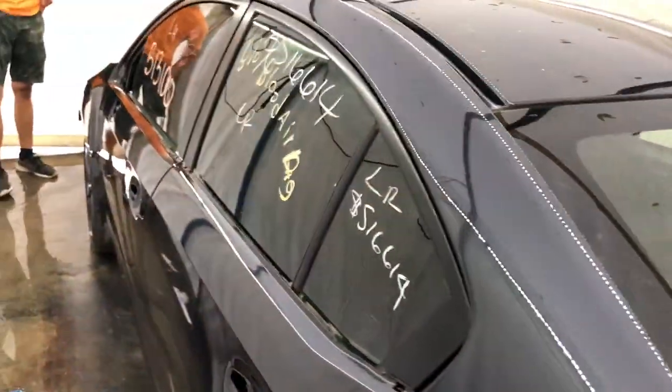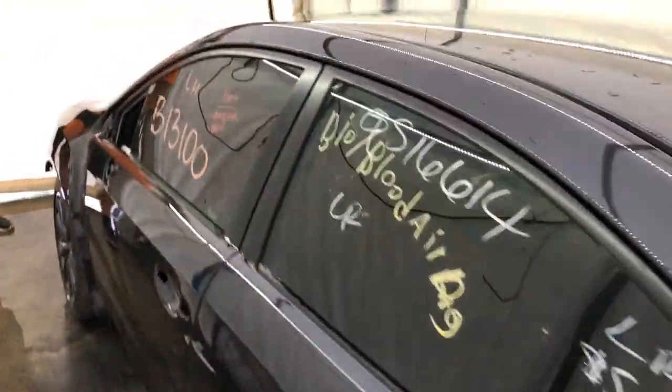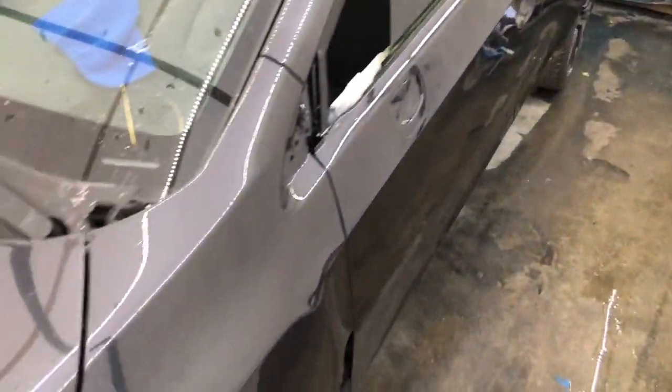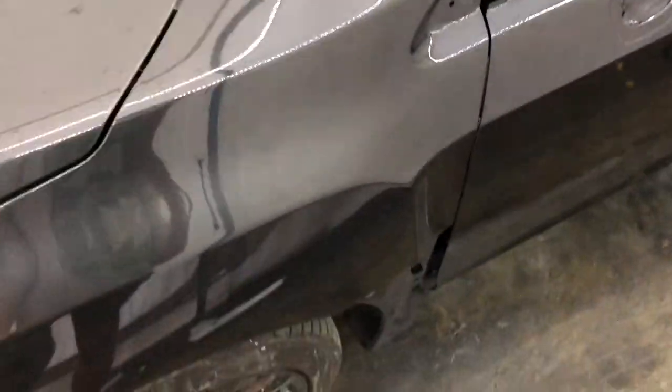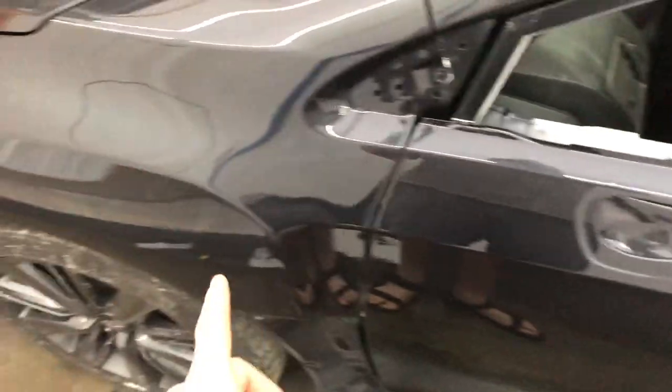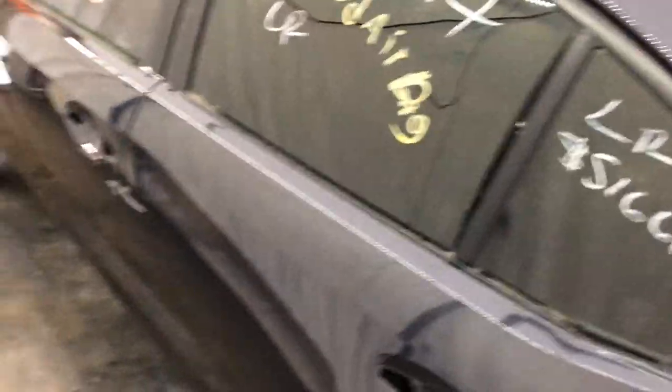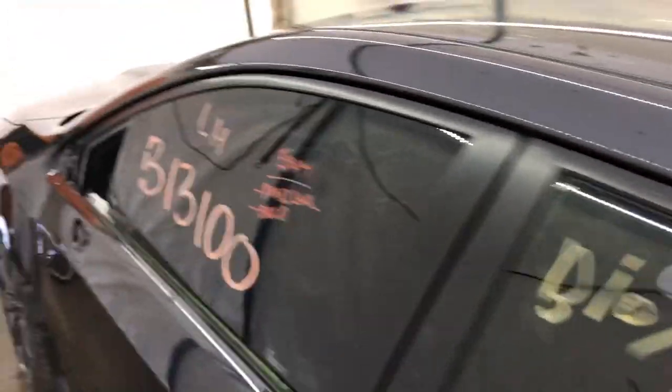Stay tuned — I'm gonna have more and better videos coming out. I'll tell y'all how to mix your paint, how to spray your paint, clear coat, and blend. We did blend this on this fender because this door was white — we blended it on this quarter panel from this door. It's looking great. It's still drying — we gave it about two hours of dry time and just untaped it.